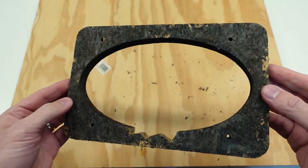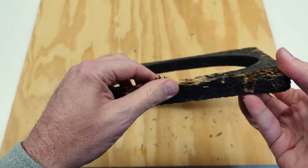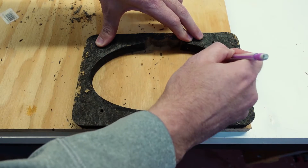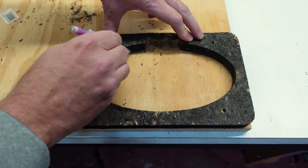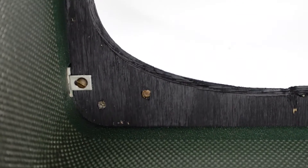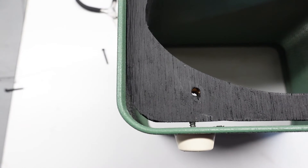One last item before reassembly: the wooden speaker support. It's really decrepit — just crumbling to pieces. Ideally I'd use a piece of three-quarter MDF, but I didn't have any and wasn't in the mood to spend $20 on a small section. What I did have is a scrap piece of three-quarter inch plywood, so I used that instead. I used the old one as a template to trace the outline onto the plywood and cut it out with the saber saw. After a coat of black latex paint, I used slightly longer screws on the mounting feet that thread into the plywood — now it's securely locked in place.